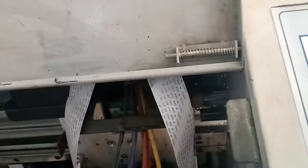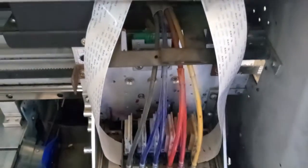There is another way you can get that error. If you did not connect this chip properly — this chip has a left side and a right side — and on that tiny chip where the cable connects, it also has a left and a right. If you mistakenly put right where left is and left where right is, the machine will give you error link fail. The fix is simple: just swap it from left to right.